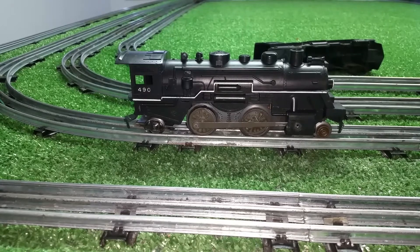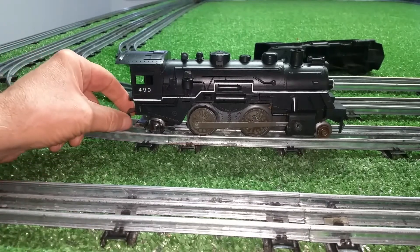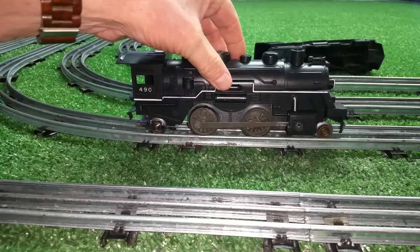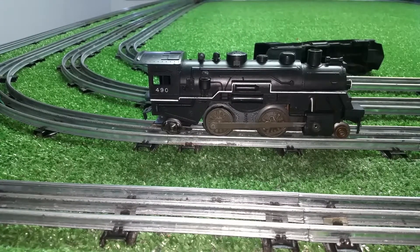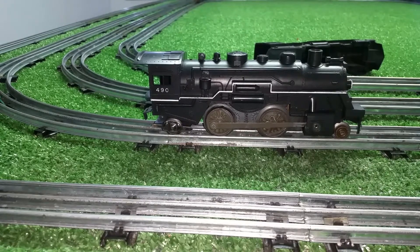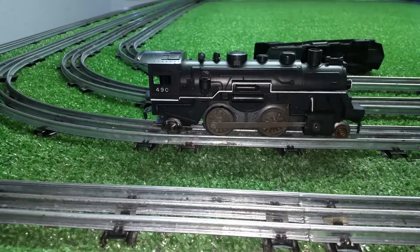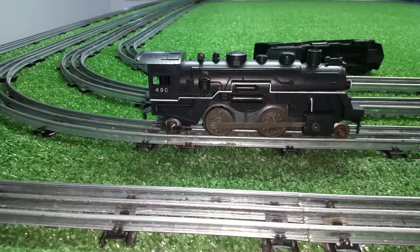I've had a lot of fun with this. The nice thing about doing this is you get the satisfaction of taking some old beat-to-death piece of junk that was just parts and putting it all together, and you come up with a really nice, really simple custom 490 that basically cost me nothing. I'll put the screws back in and be running it some more. I will replace that front screw with probably a screw and a nylock — a 6-32 or 8-32 screw — that way I can tighten it to whatever tightness I want and it'll stay there.